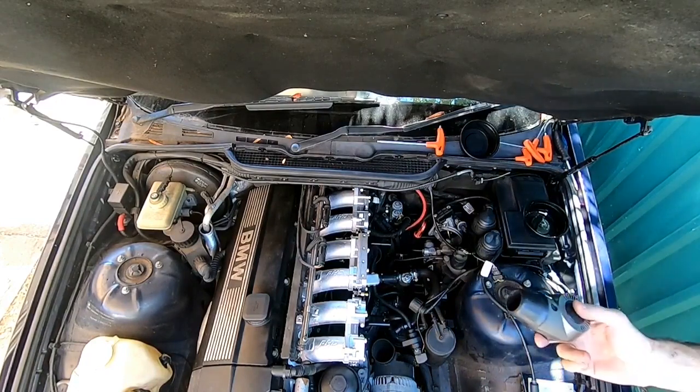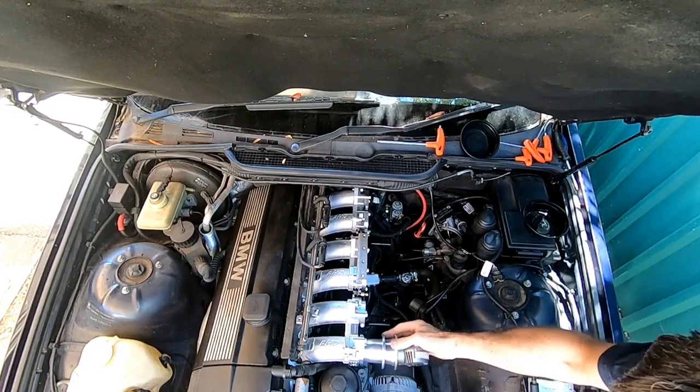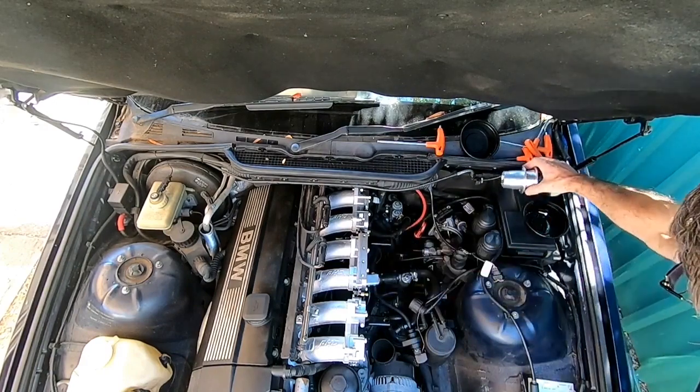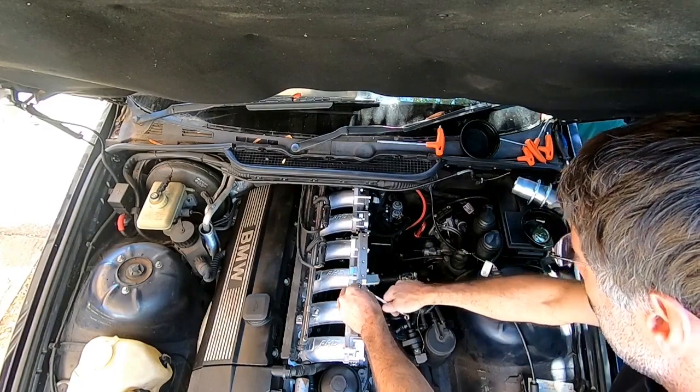The engine is basically ready to start. We need our trusty flow meter — we can go along and check what flow we've got and check the balance. We'll need our two little screws to adjust these.